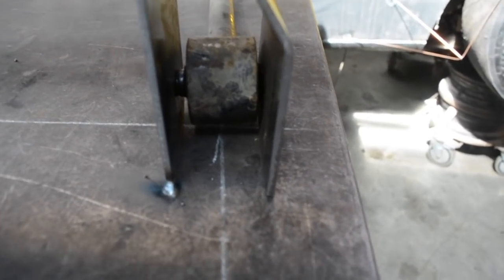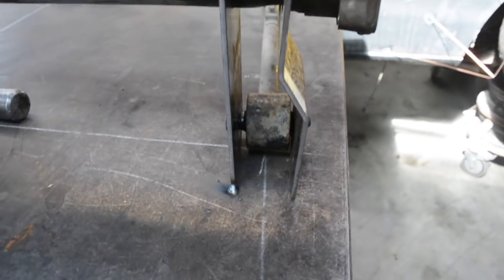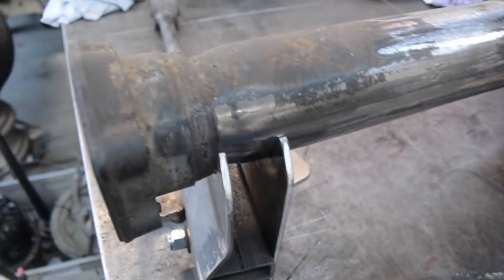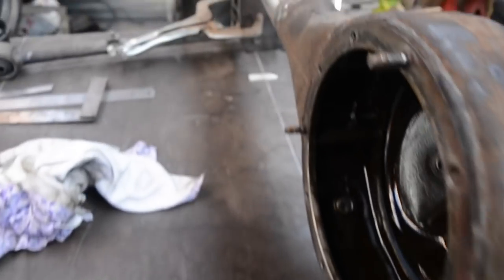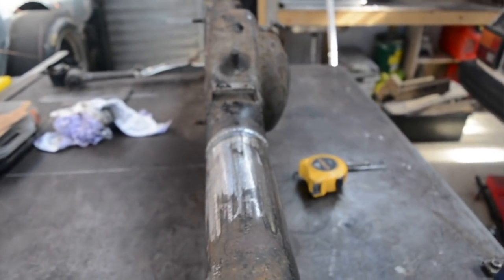When it comes time to, I'll take the lower arm out and I'll space it with something that's the right spacing, and I'll do it up tight to make sure it clamps up square. It's just sitting there for the moment, but have these all ready to weld on, grind up the housing, use a piece of 50RHS to clamp the gap right, tack to the bench, lower arms are following that diagram. And I've set the pinion angle.